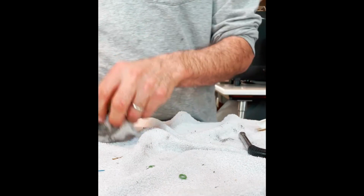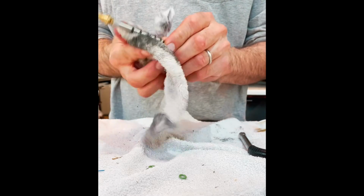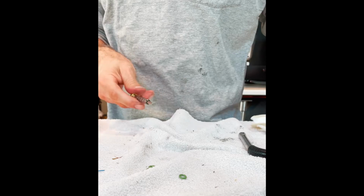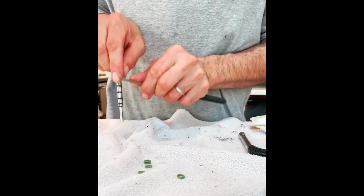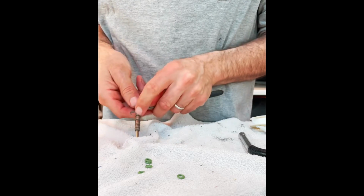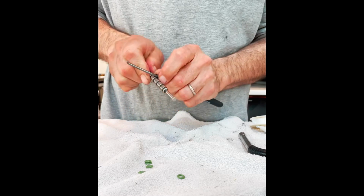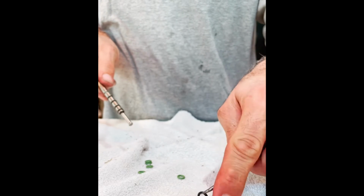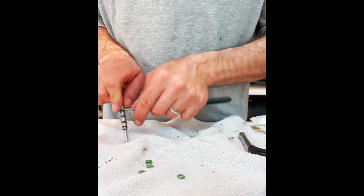Let's take a look at the valve stem itself. You can see it has 5 O-ring washers on it. So I'm going to take my hook awl and I'm going to grab the first guy. You're going to be replacing these, so if they broke, it's not a big deal. Sometimes I like to get a couple of them off safely, just in case one of the new ones ends up damaged. And I like to start with the top one because it rolls over the surfaces of the next in line. I've found it a little bit easier.